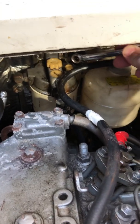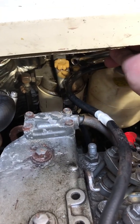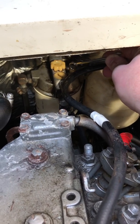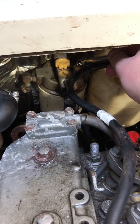So what I was doing initially — what I found — when I was trying to start this engine last time, I had not tightened that back down all the way. So when the engine was running, it was actively sucking air into the fuel line. I just completely forgot to tighten it back all the way down. I'm so mad about that.